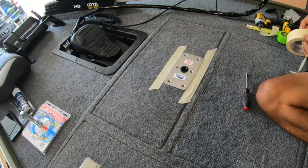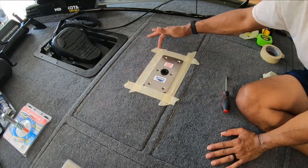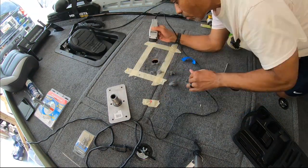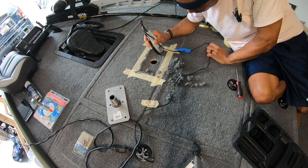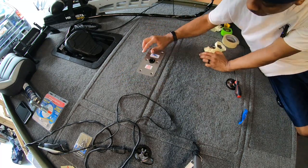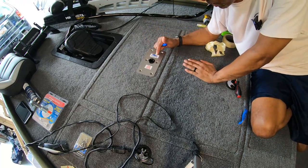I've marked the edges with tape and will shave inside the tape. I'll go a little conservative inside the line — if I go outside too much I can't fix that. After shaving and dropping it in, I can already see where it's completely flush with the carpet. I'm not even going to move this — I'm really liking how it fits. I'll go ahead and mark my holes and drill them out.